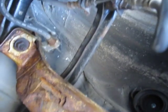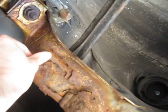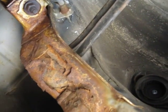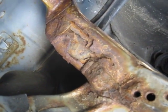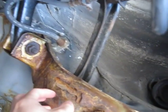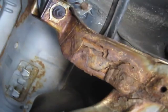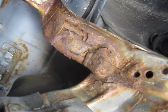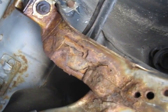Here's the camber arm — that lets you adjust camber on the rear trailing arms. These more or less don't do anything anymore. Even though the car is in alignment, it was getting really bad camber wear. I discovered that the mounts these arms go to are more or less just hanging in here — they're still attached, but so many layers are gone that the whole rail flexes, and it doesn't do anything.